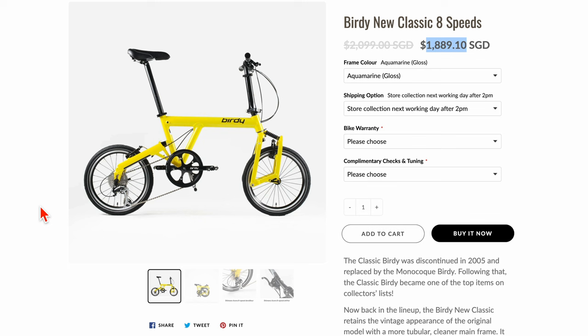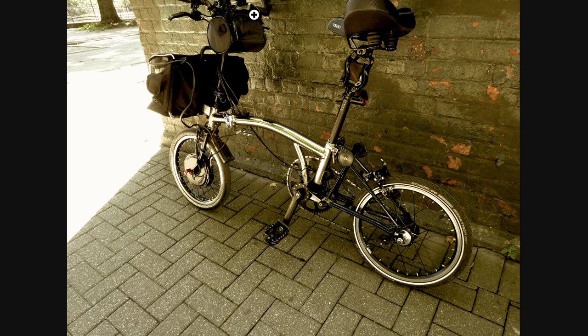Why would I want to put it to the front? Because I wanted to be able to pedal as I was going fast. If you use a throttle, you can go as fast as you want to. But I wanted a pedal sensor — I wanted the e-bike to feel like a bicycle. I installed a thumb throttle in the beginning, but I just did not like the whole moped experience. So you can see there is a pedal sensor here. As you turn the pedal, there are magnets in it, and the sensor notices the magnets moving and sends a signal to the controller, which you can see and manipulate.